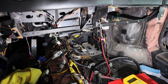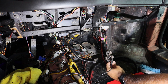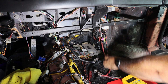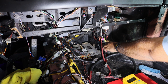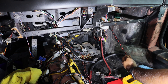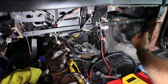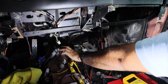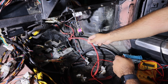We're now in the cabin of the car. We're going to start with the battery terminals — down here we have the negative terminal of the battery and over here we have the positive. The positive terminal actually splits into two wires: one that goes up into a fuse box here, and another that goes towards the back of the car towards the engine. We're going to focus on the cabin at the moment. This wire goes into a fuse box and then splits into two.